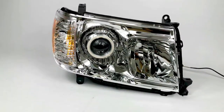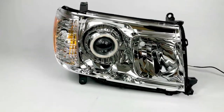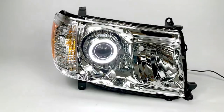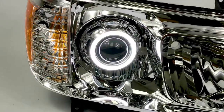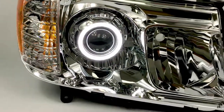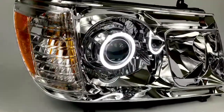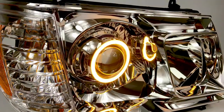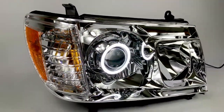Then of course you've got the halo right on the front of the shroud — it's 90 millimeter, the HD LED by Diode Dynamics. We're going to turn that on for you. So it's got a white running light mode. You can connect this to just your parking lights or to a switch power source in the fuse box. It's also connected to your turn signal, so anytime your turn signal is activated it's going to turn to amber and then go right back to white mode.